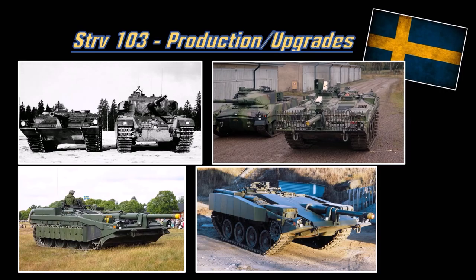Here is the actual production model of the S-tank. The Zero series went on to the A series, which quickly got upgraded into the B series. The A series had problems with the engine - lackluster engine - as well as the hydropneumatic suspension and some armor. They improved it, tweaked the suspension and put a fence on the front. That's the B series with the rib armor. For the C series, they added fuel tanks and increased the diesel engine from 240 to 290 horsepower. It has two engines - one diesel, one turbine - both working together, with diesel used for the aiming. The C series also has a better fire control system with a better laser rangefinder. The D series has reactive armor and applique armor on the hull. That's the STRV-103.